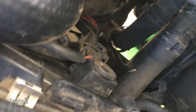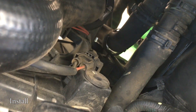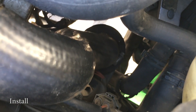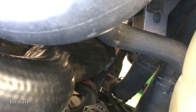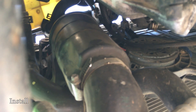There weren't really any instructions, but there's a coolant hose right there with a clip that I pushed to the left, and then that loosened, so that's free. Behind that, that big black unit has — I believe it might be a T25 — that holds it in place, so I'm going to loosen that, then this whole thing will be loose. Since I already have the lower intercooler off, I'm just going to loosen this and pull this entire piece out. If you were just replacing the resonator yourself, you technically could remove the clamp in the middle where the camera's pointing, and the clamp underneath there, loosen those two, pull that resonator out, and put the new pipe inside.